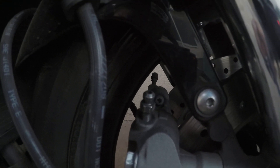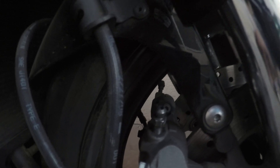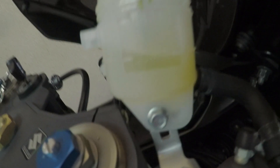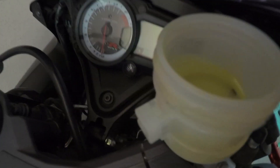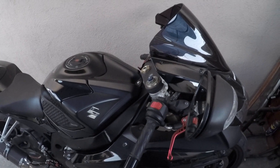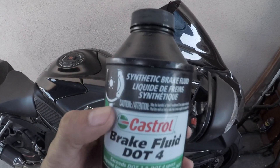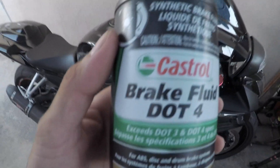That's where you connect it — make sure it's really nice and tight after you're finished so you won't be dripping oil and have a major accident. As you can see, it's a big difference — it's clear now, that's the way it should be. The Gixxer recommends DOT4; I went with Castrol synthetic brake fluid DOT4. It's my first time using it but I've read a lot of good reviews about it.